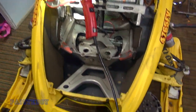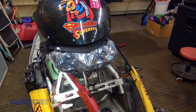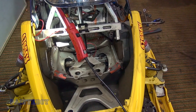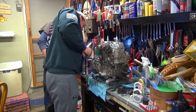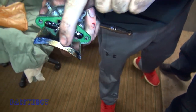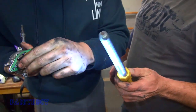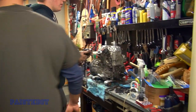Under the hood — fully pulled. We really got to get this thing working good. There's some thought of getting another sled, but once this one is fixed up we should be all right. Looking inside — it runs way too rich. See that buildup right there? Yeah, it runs way too rich. I cleaned them last year. You've got to figure out why it's running so rich — that's carbon buildup.